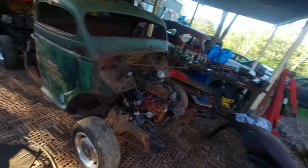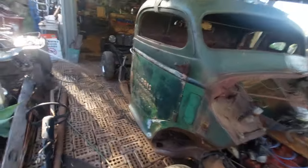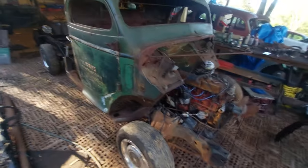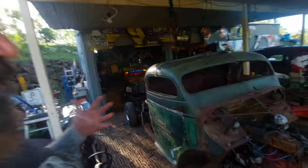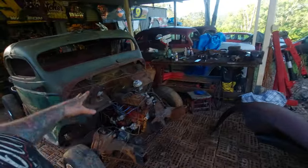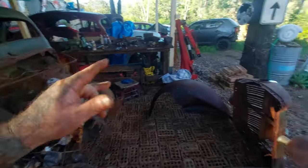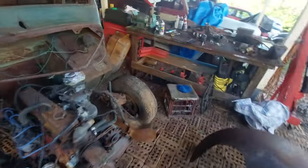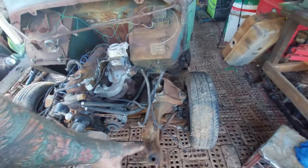There we go. We've got the back trimmed, just a couple little trims, and it is now sitting nice and level to the chassis. So this is pretty much where it will sit within a couple of mil, you know, 1/16 of an inch or something, where you may be out back or forward. But what we will do before we finalize anything is we will get our front end mounted. To do so, we're going to have to trim all the inner guards, both sides, and trim the chassis ends as well. So we'll have to do some measuring for that.